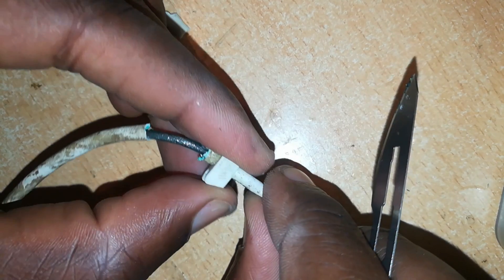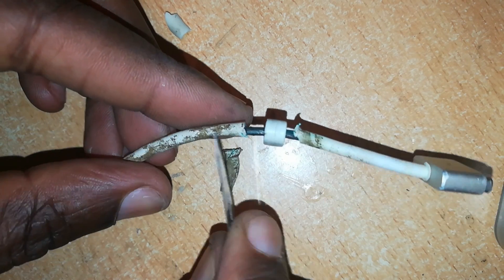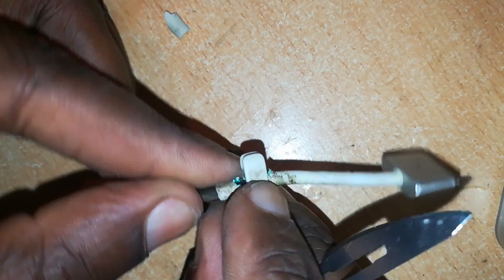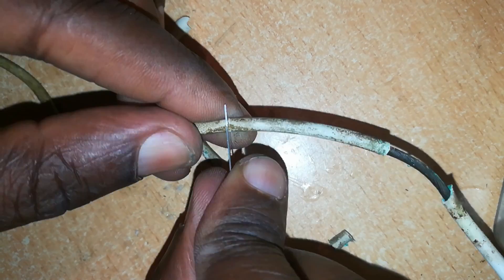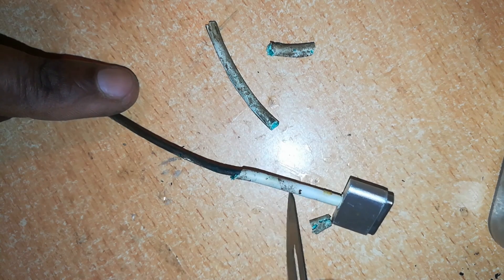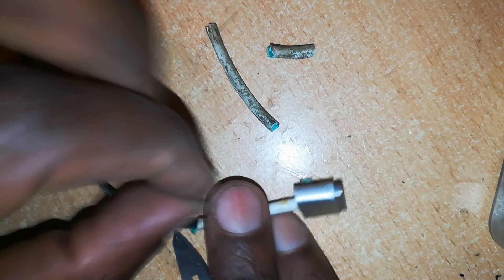You can always clean that later. Then pull the cable holder on top of the good portion of the cable. Make sure this section is good — if there is any sign that it's not in good condition, move back and cut again. This rubber insulation feels very weak up to about this point, so I'll cut it all the way back here. Good — the cable is neat now. We can slide the new insulation all the way up here, and we'll cut it somewhere here to hide our junction under the rubber insulation.